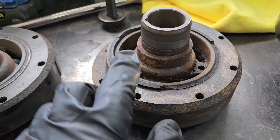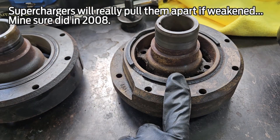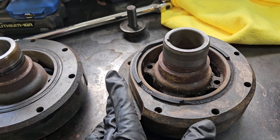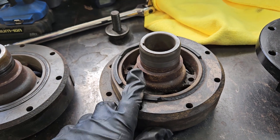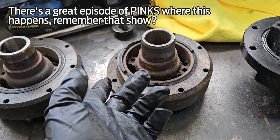When this happens, your balancer is going to separate — it's just a matter of when. When it separates, this outer ring will fly off, which is quite a heavy piece of mass, and your engine will also be unbalanced. Generally, if it keeps running, it breaks the crank. Pretty permanent stuff.